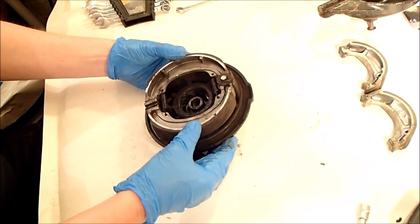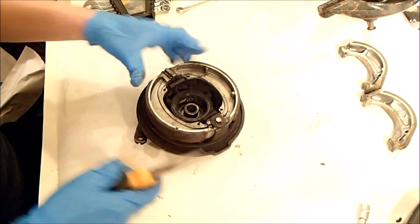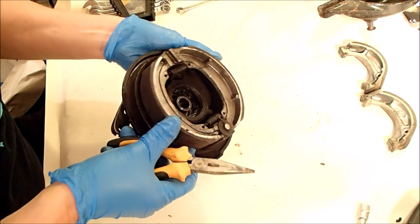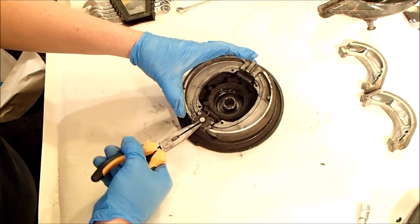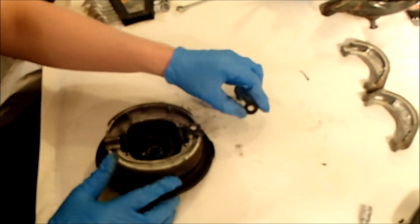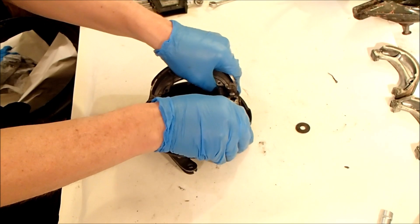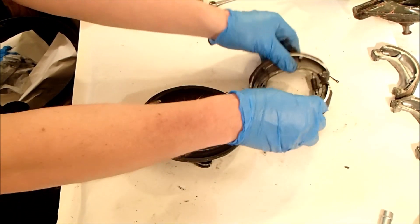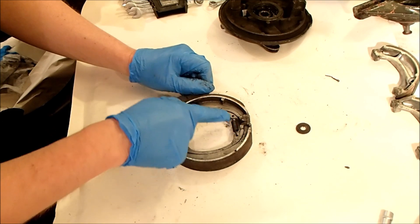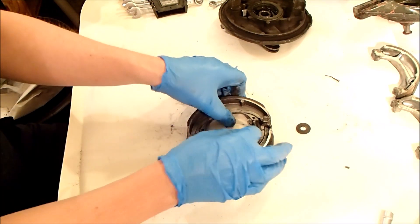Time to dismantle the larger front brake. This is a little bit more complicated. We have the split pin that is holding down this washer, and again just one arm on the square pin. That's the split pin removed. Then we have this washer. The way it's come out, the springs are attached across which is very simple — the hooks are coming up from the bottom. Whether that makes any difference or not I don't know, but that's the way it is.